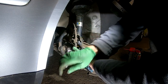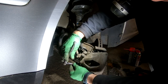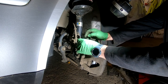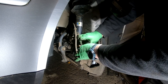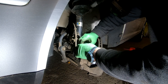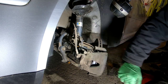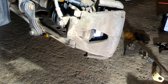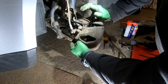Let's do these up. Don't have to be red — it's really tight but just adequate. You'll feel it when you take it off. These aren't a big thread — I think it's only M8 — so don't need a lot. And then you have to try and get this thing on, manoeuvring it so the wire is out of the way and get it on there. I've had problems with these before getting them on. Beautiful — she's gone. So that is the pads changed. Give me a moment and I'll go and pump the brakes up and you'll see it all compress up. Pop our little caps back in, and that is it. Done.